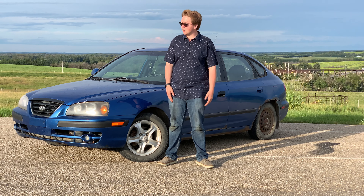Anyway, what we have done thus far that you haven't seen on camera: we replaced the rear brakes — there wasn't much left of those, so we got the pads and the rotors changed back there. We also replaced all the drive belts. I figured if one exploded, the others might as well, so we got all those replaced. I also replaced the AC compressor, gave it a recharge, and now the AC is blowing ice cold, which is great.